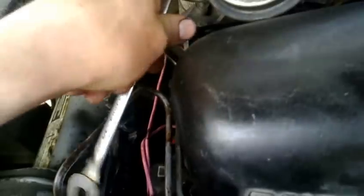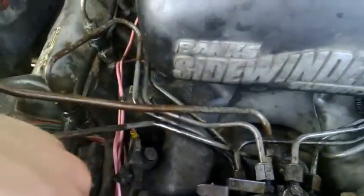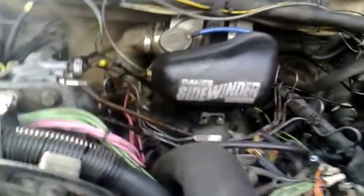Okay. Now back here, number seven, you can see that it's all wet, so let's tighten this guy down. And number 6, wet. Let's tighten that one down. And number 5, wet. Or 1357, so this would be number 5. Give it a tighten. Number 1 is still dry, along with number 8 and number 2. So these two middle ones, that's tight, and that's not tight. So it could start right now, so if I need to, I'll just drop my wrench and pull that off.